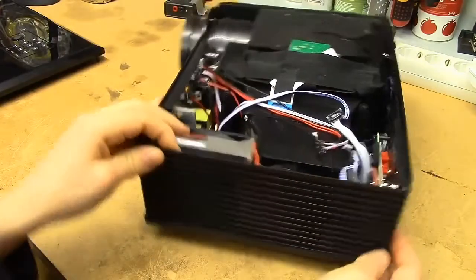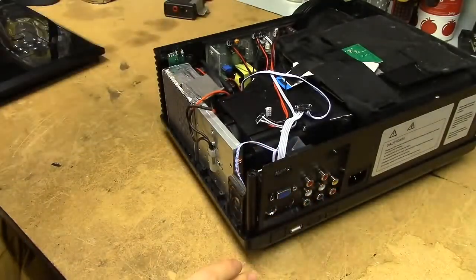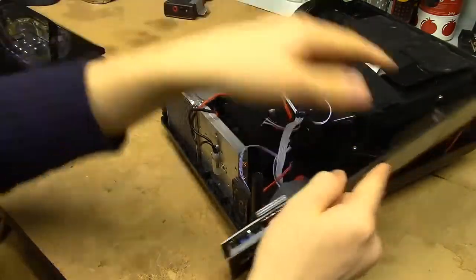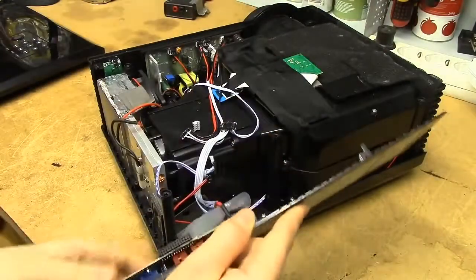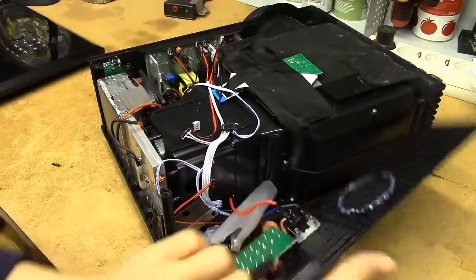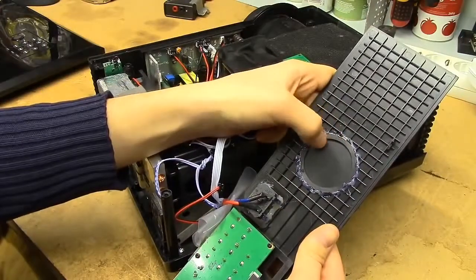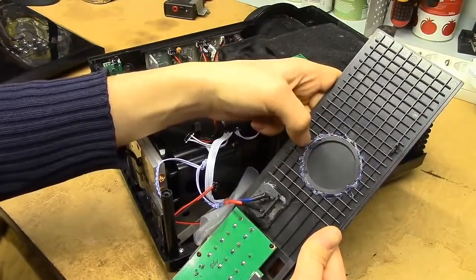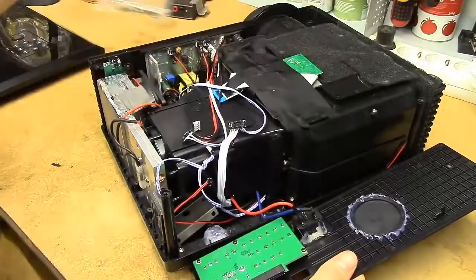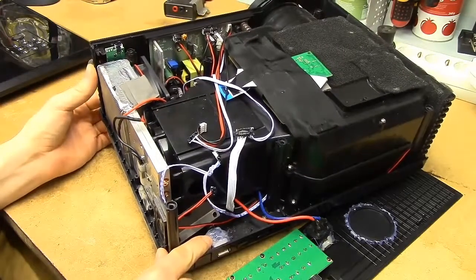And that's certainly not made better by the exposed metal parts here. Once you start the disassembly, the entire thing basically just pops apart. This box is very modular in design, which is a pretty nice touch — it comes apart very easily. This mount was also broken from the factory, which means you could theoretically just yank the power cord out and get the panel along with it. Back here there's some round thing hot glued in — perhaps for another model where they had an incandescent or gas discharge bulb. And down here there's a USB plug hot glued in place.